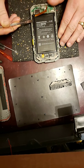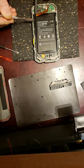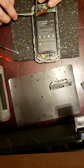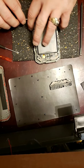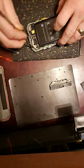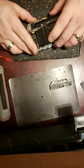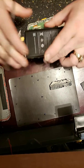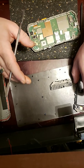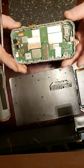Start on the side and use something to get right up under the bottom just a little. Pop the other side — it should come out relatively easy once both sides are popped. You'll probably have to pry up here just a little. Move your battery off to the side and you'll have access to your board.